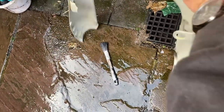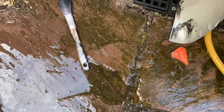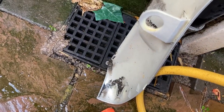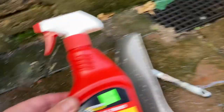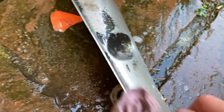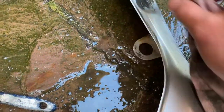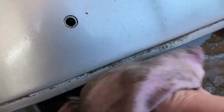We can get that bottom side up too. The Gunk remover sprayed on and left for two or three minutes — mostly the whole lot came off just with a rinse. Had to use a little brush on the thicker oil bits, and need a little white spirit on that section. Unfortunately ran out of Gunk Ultra before doing the bottom of this other part — real mess. I've got this other product, Wonder Wipe spray. Sprayed it on there, take a cloth, and you can see how it starts to come up real quick — a light duty cleaner that gets loads of this kind of stuff right off.